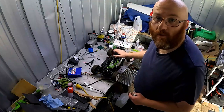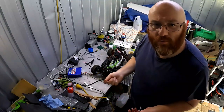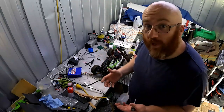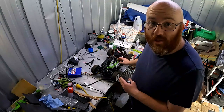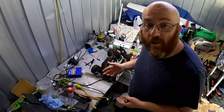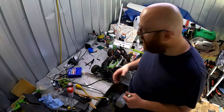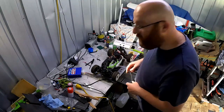All right, guys, so we're ready to start. Bear in mind, as I said, race engines and possibly some pull start engines too are basically seized. So even though I've preheated this, it could still be a little troublesome to start. Be patient with it. I've made sure that the fuel is primed into the carb. I've got all the mixture needles set. Depending on what engine you have will determine what the factory settings are. I also like to check the factory settings, that's just how I am. So everything's ready, so hopefully it's ready to start. Let's see what happens.